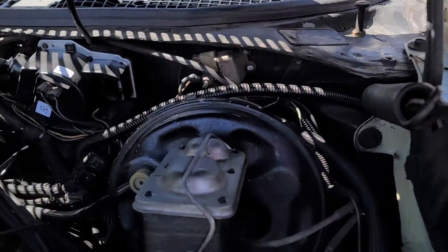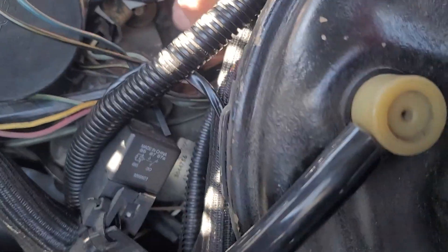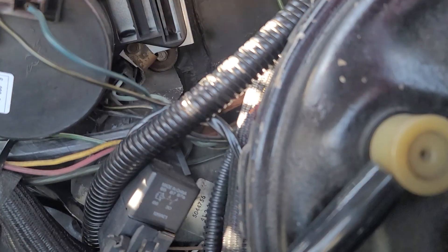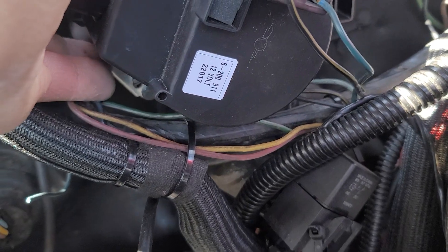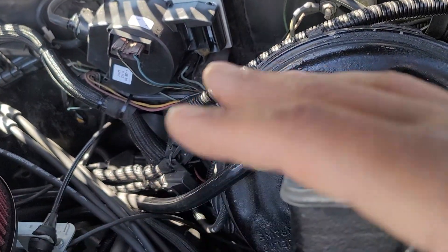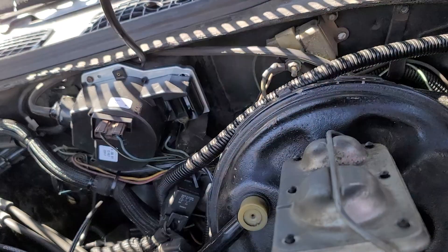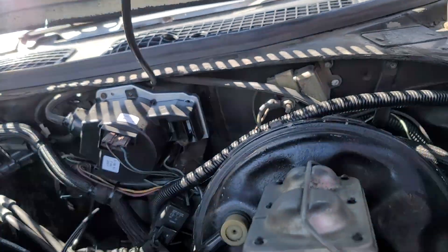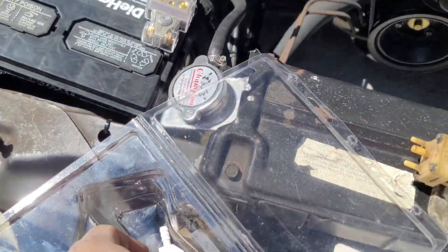You just come in here and there are three little bolts you have to take out. The first one is here — that's one. The second one is here, and be careful when you take this one out because you can see it has a ground on it. The third one is right there. Once you take the old one off, putting the new one on is super simple — the wiper motor doesn't have to come out at all. The new one also has very nice instructions; they tell you that if it doesn't work right away when you connect it, just flip the connector. Another nice thing that the new one came with is these little adapters.